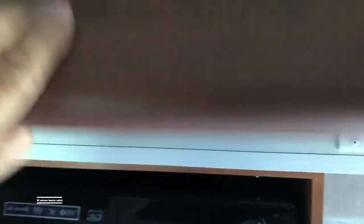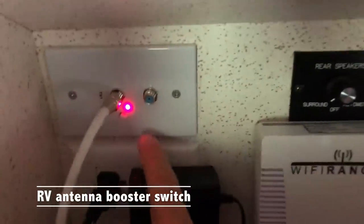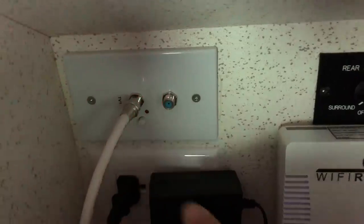Each of these chassis has a built-in battery disconnect system that requires no tools. The manufacturer recommends every 21 days, but because we add additional items requiring memory, we recommend every two weeks if you're going to store the vehicle for more than two weeks. What about battery loss inside the coach? You have a number of items that will draw power whether you're aware of it or not. One of these — unfortunately — is the antenna booster. When the antenna booster is on, it is basically your highest draw of 12-volt power in your coach. If that's left on, it will drain the batteries at a quicker rate, and all it takes is somebody accidentally pushing the button while reaching into a cabinet and not realizing it's on.